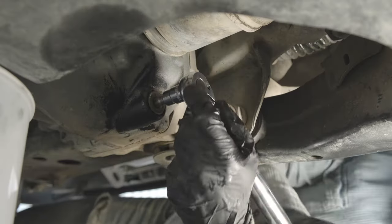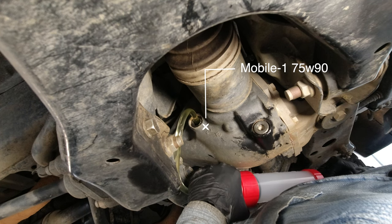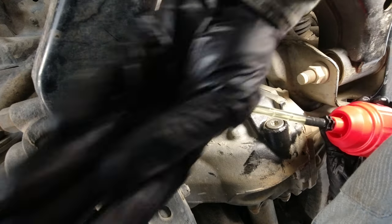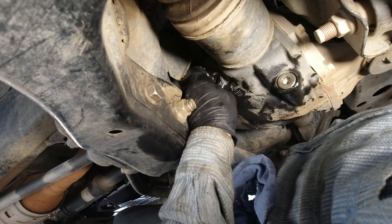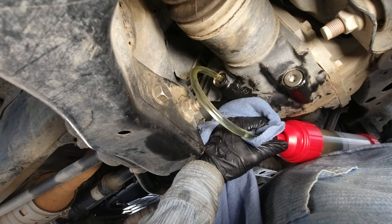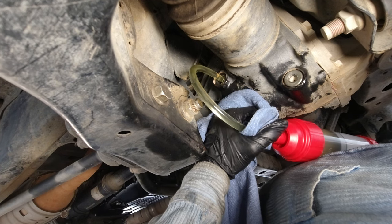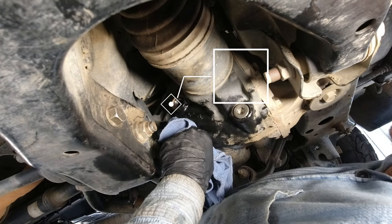Moving on to the fill-up procedure, I have a few notes. First, measure how much fluid you're putting in rather than relying on overflow from the fill hole alone. Here I'm getting some overflow because I added the fluid a little bit too fast, but I wasn't sure if I had actually filled it or if it just hadn't settled quite yet. So if this happens to you, you can check it just by feeling inside of the fill hole — the diff fluid should be just at the line of the fill hole. In my case I needed to add a little bit more, and so now I'm slowly adding and you can see it just starting to overflow. But I still think it's good to measure how much you're putting in and use the overflow method just to validate that.